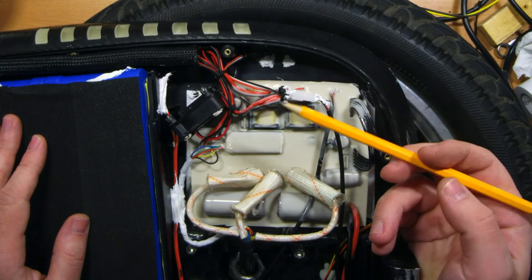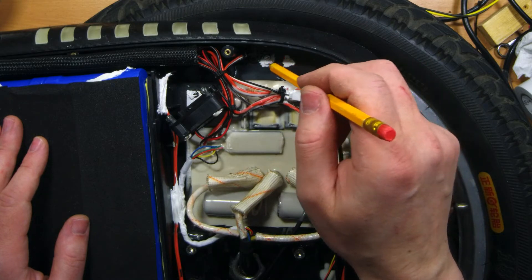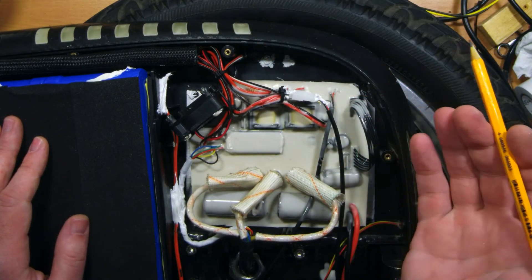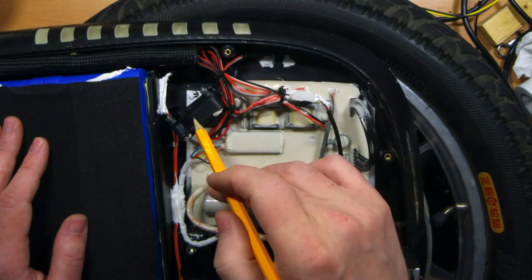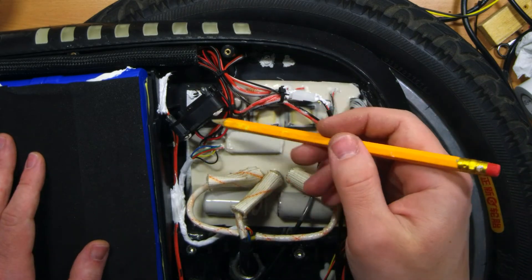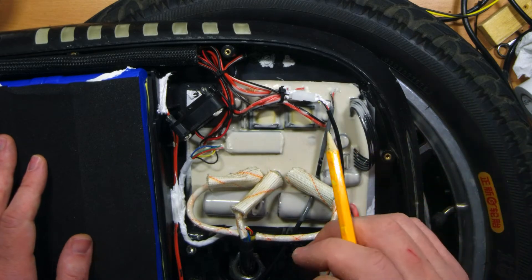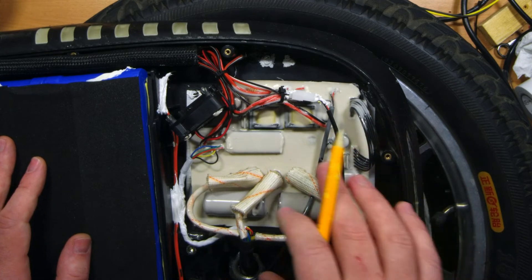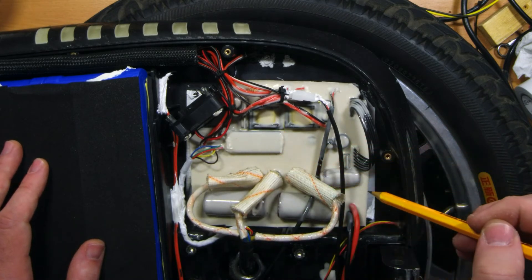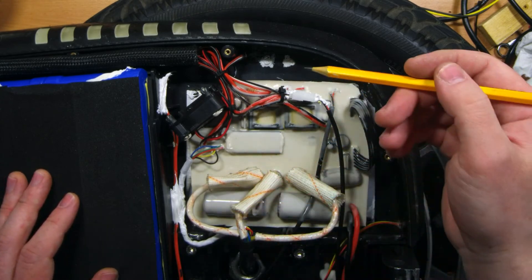During my work with the controller board, I decided to make a small upgrade to the cooling system. Originally the fan was installed here — you can see two spots of sealant covering the holes where the ventilator was installed — and it blew directly onto the DC-DC converter, which I consider a bit misplaced since the hot area is elsewhere. I moved the ventilator to a better position and also moved the DC-DC converter slightly lower to fit it. Although the fan blows on just one side of the controller board, the thick layer of thermal compound covering the board transfers heat from all areas, so this upgrade will help the controller board run a little cooler than stock.